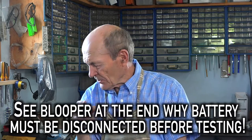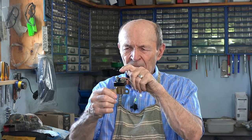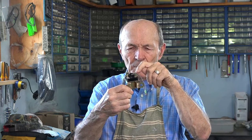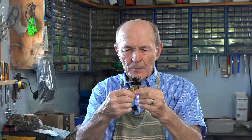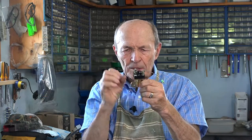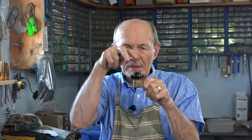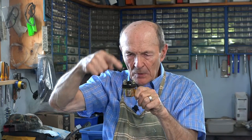That's why the solenoid is in there. The solenoid — this little silly little thing right here — is really kind of a relay. All it does is connect from the battery positive to the battery positive which runs to the starter. There's too much current flowing to have a little toggle switch for the starter — you can't just flick a little switch and the starter spins; you'd burn that switch out in two tries. So it has this heavy duty switch called a solenoid. This wire runs up to the ignition, up to the key. When you turn the key, this wire gets power, runs down, it clicks, makes the electromagnet go up, and it joins these two really heavy bolts. There's a heavy cable from the battery to one bolt and a heavy cable from there to the starter. So it's a heavy duty switch activated by the key.